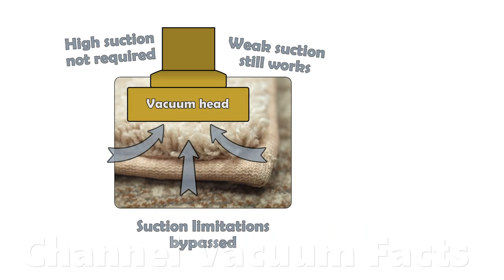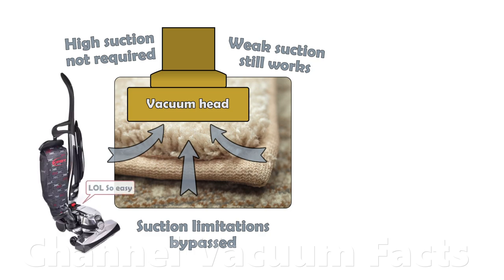So what about carpets with porous backing? Porous carpets offer very little resistance to air flow, and so strong suction isn't required to generate sufficient air flows through the pile. The air also flows directly from underneath, more easily removing dirt that may be deeper down. These carpets are much easier to clean. In principle, low suction machines — and especially those which generate high air flow at the open hose like the Kirby — shouldn't struggle to perform as well as high suction cleaners on this less advanced type of flooring.